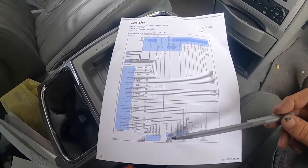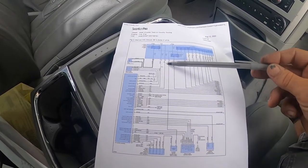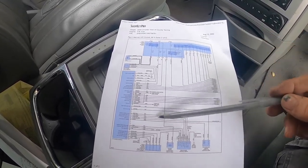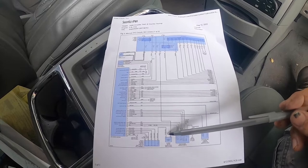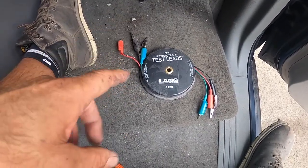The first thing we're going to start with is the blower motor. There are two wires going to it: a dark blue wire that goes all the way up into the fuse panel — that wire is integrated in the fuse panel and should be hot all the time. The other wire is your ground wire that gets the signal from the resistor. Let's go ahead and start with the dark blue wire and see if we have power.